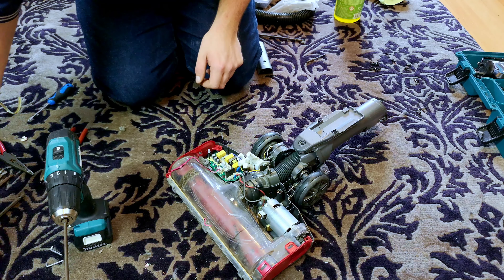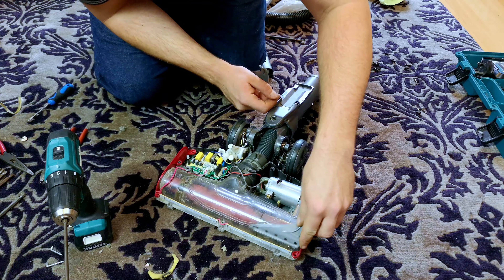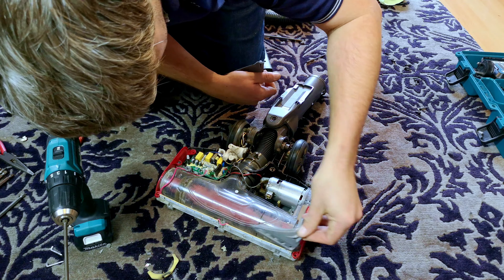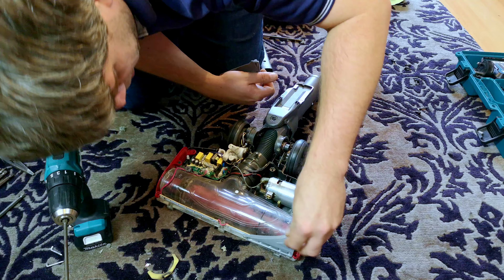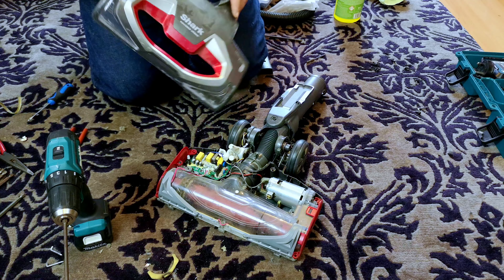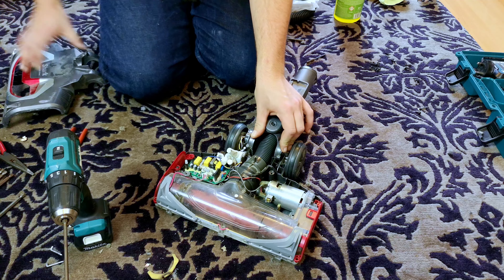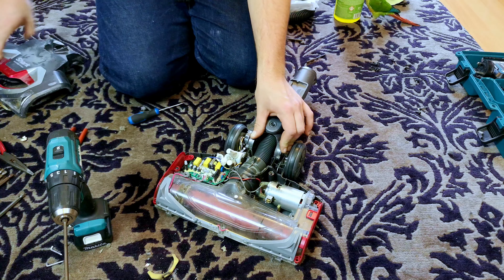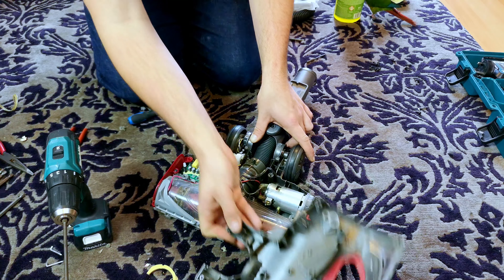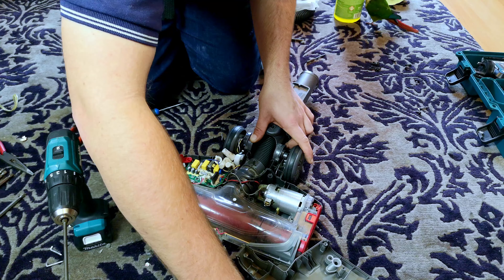I can't really clean much else on it because I'm not taking the brush roll out — I don't care that much. So it's time to put this back together, starting with the LED housings that will fall off on you. They go in the bottom and then clip on the top. Now as soon as you move this head, if you need to move it, they will fall off — so bear that in mind. Then making sure that everything down here is sat properly and that the wires are not going to get pinched. Don't lay the top housing down yet — fit this little chap here, which again falls off for fun. It just slots on there, for the motor.